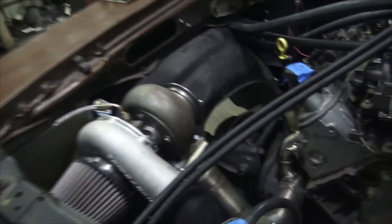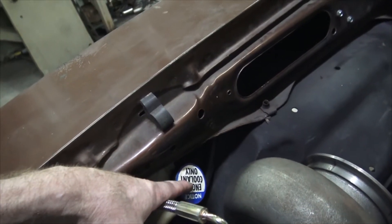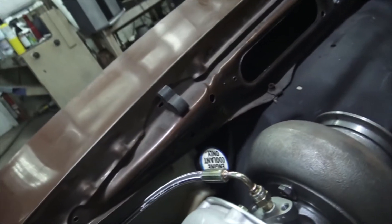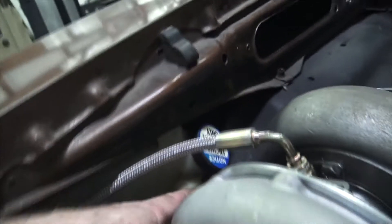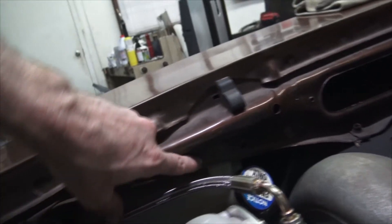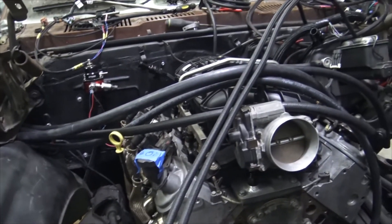These are done too, except we're waiting on that one spark plug I'm ordering right from NGK. The turbo is hung by the manifold, oil filter, all of it clamped down. This guy caused me all kinds of grief — the water overflow tank was pointing right and it literally came down and almost touched the turbo. So I stuck a tube in it, heaved it up, bent it back and around, then moved it back because it was sitting forward about an inch and a half. Drilled another hole and now it sits back there. We've got a turbo blanket showing up — hopefully that'll work, otherwise we'll just make a custom overflow tank.